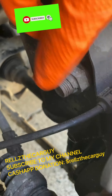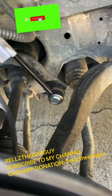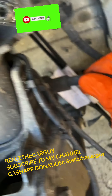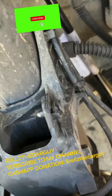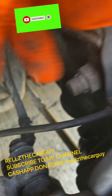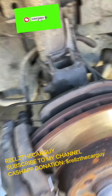You don't want a lot of tension on this. You want to pop this plastic clip off and move it so you've got room for that to play around. Once you take these two bolts out, don't pull on this brake line right here.